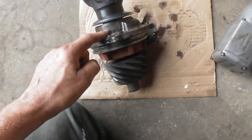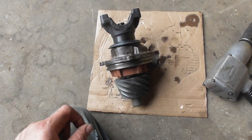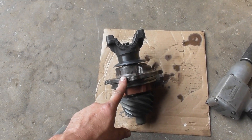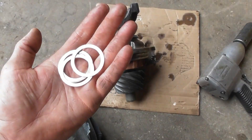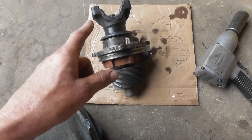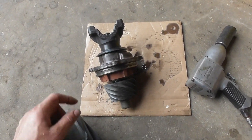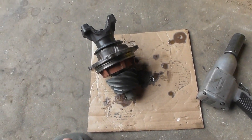So I took the factory solid shim spacer and shaved it down. With ten thousandths it was still too loose, I shaved it some more and it was too tight, so I went to an eleven thousandths shim and I'd say it's perfect now. I still need to take the back part and put the seal in it, and then it should be the last time it's apart. I think I've had that pinion in and out of there about eight times — that's what it takes to set them up with these solid pinion shims.